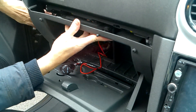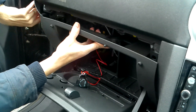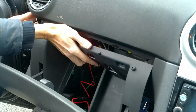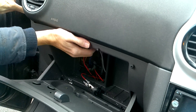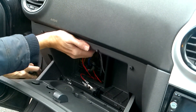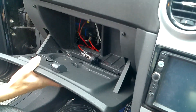When you put the glove box back on, the rubber seal at the side here has to be put in place. We just feed it over the top like that, then push the glove box into place and get the screws back in.